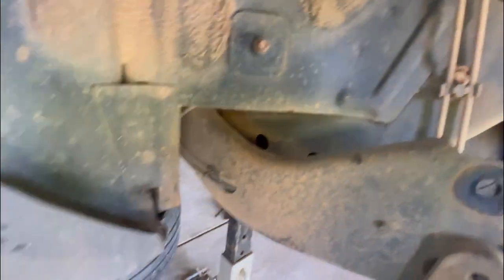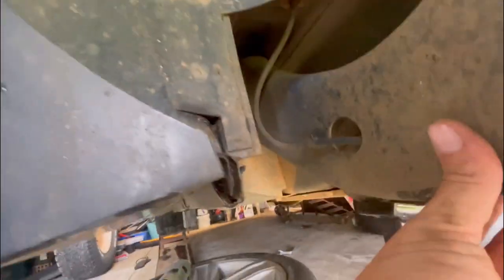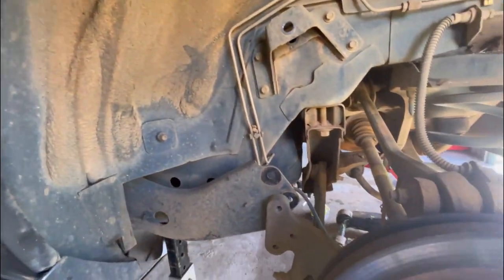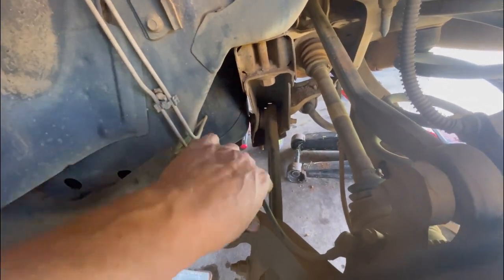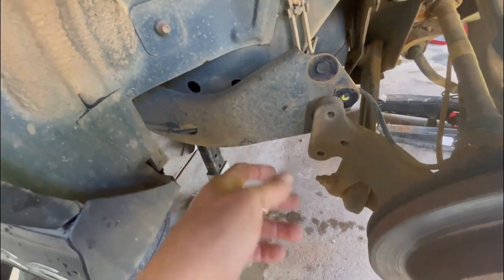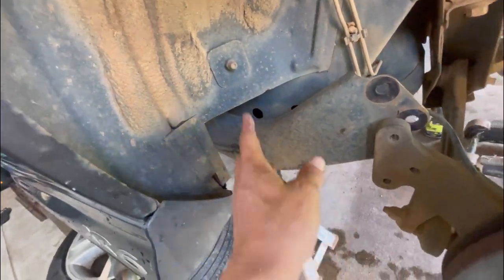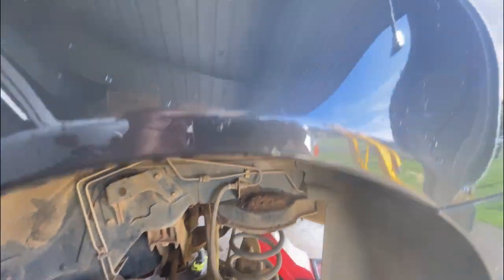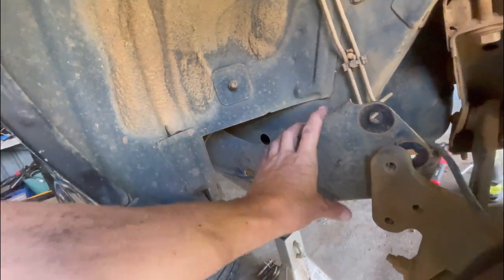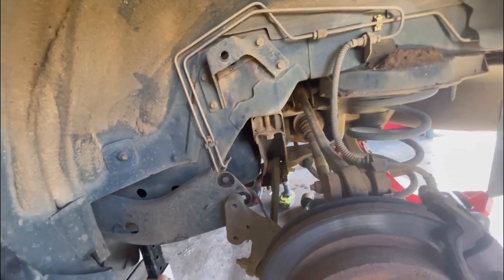Just as I was looking here, this bush here is completely stuffed — it shouldn't have that much play in it. It's completely worn out. On the work order they said lower control arm so I assumed it was these arms here and ordered brand new ones of those. But that bush is going to need replacing as well. You can press the bush out of these arms, but I know the other car over there — the wreck — has Nolethane bushes up here done at some stage. So I'm just going to swap these arms out with the ones from the wreck and that'll get rid of that issue.